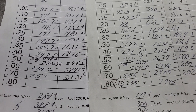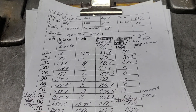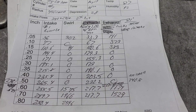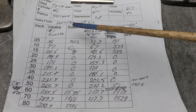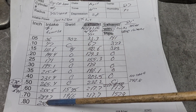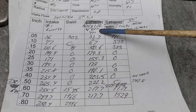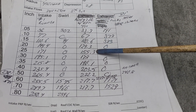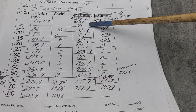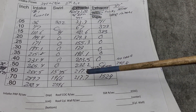Now let's take a look at it through the intake manifold and carb. I did these on the same page — two different heads — so it'd be easy to compare. These are the Chinese EQs on the 340 Victor with my 770 carb. These are the New Zealand EQs with 2.02 intake valves on the Performer RPM with the 770 carb.